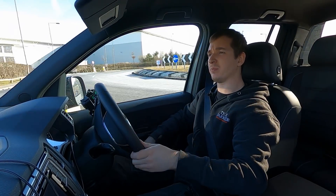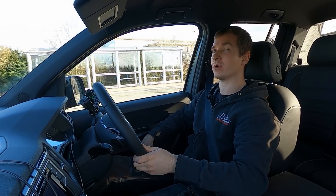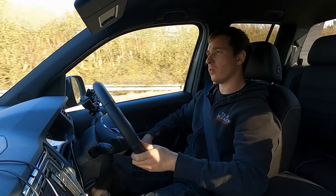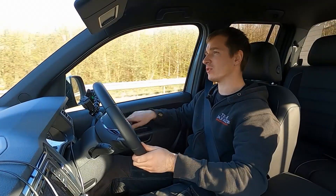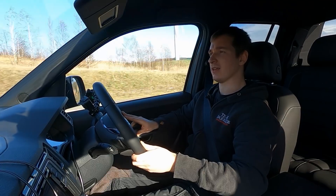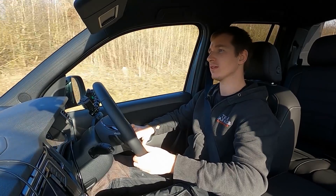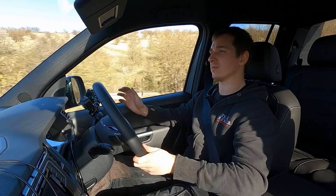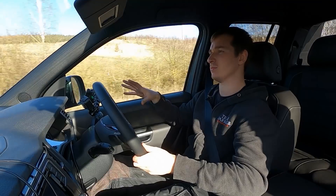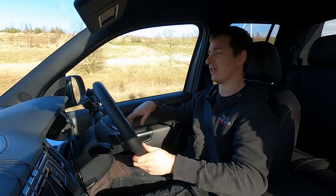The next test is to get back on the dyno with the DPF removed and see if it makes any difference to power - which I think it should with 700 millibar of back pressure. There's still quite a lot of stuff to do on this car. I wanted to put the 2263 turbo on first - this is currently a 2060 GTD - but that won't be with us for another couple of weeks. We originally planned to go straight to the GTD 2872, but most people probably just want the standard bolt-in slight upgrade.